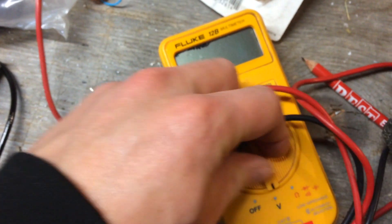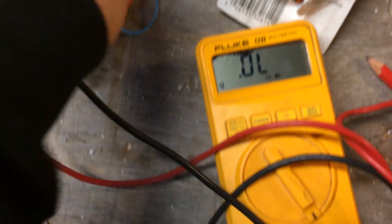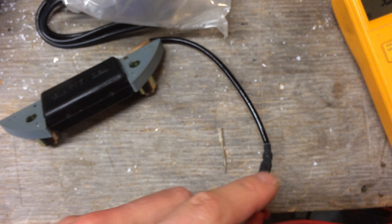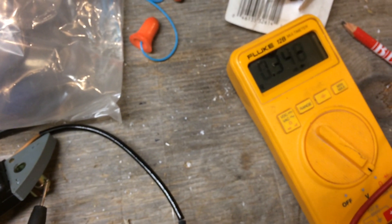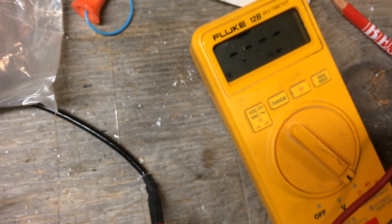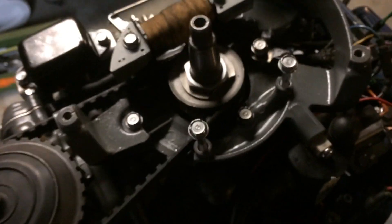To know you have a good one of these coils, put your multimeter on ohms — it beeps when you touch it, but we care about the resistance. I put one probe inside the wire and it reads about 0.27 ohms — it's got a little resistance. The one that was bad had zero and didn't beep; you could tell it was bad right away. So this new one is a positive sign — let's install it.